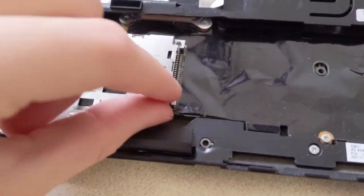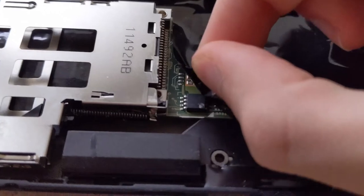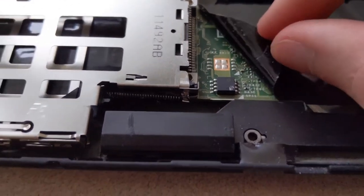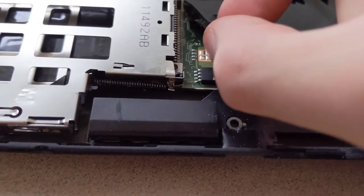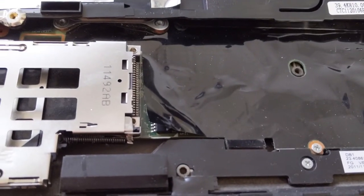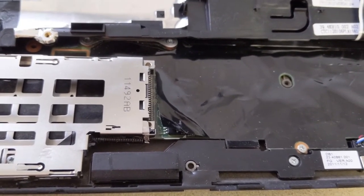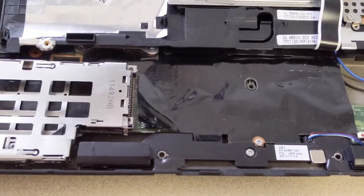What you're going to want to do is lift up this little piece of tape and you can see the BIOS chip is right here. This is actually what you're going to want to attach your clip to — find a way to pull this back. So you're going to want to attach your clip to that. I'm going to go ahead and get my clip and cut to me attaching this and all the wires. I'll have a blog post linked in the description on how to do all this, because you'll want to know the pin-outs for everything so you don't mess anything up.